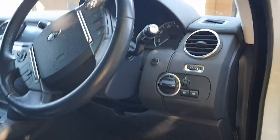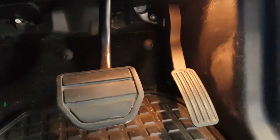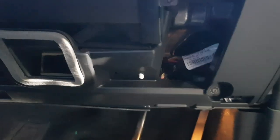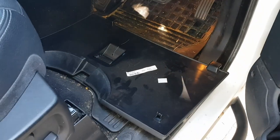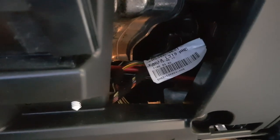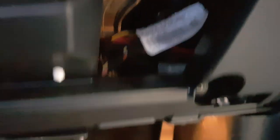We're going to go under here and basically here is the throttle right there. All I'm going to do is pull down on this section here in the middle and that just came straight off. It's supposed to just flip down but it'll be fine. It's just got some tabs here and here and holds on from there and from there, so it's just a panel that comes off. There is some wiring inside there — I'm hoping the wiring and the switch should be able to come straight out of there, no problems. It doesn't look very easy to get to from the bottom, so I'm hoping it's fairly easy from here.